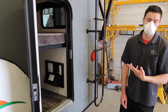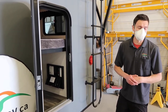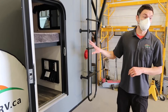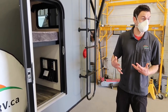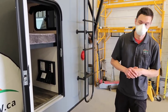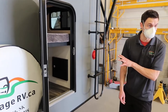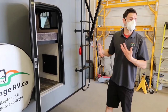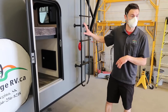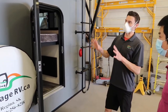I'd highly recommend buying a little two-dollar box of 15-amp fuses and keeping them in a drawer — you'll probably never need them, but they can save you in a pinch. Normally when something on the panel flips or pops, that's an indication of a bigger issue, so just changing the fuse may not actually help, but it's good to have them on hand. Also worth noting about the converter panel: there's a fan that runs inside. With all the lights on it's fairly loud, but at night when the lights are off and it's not working so hard, it gets much quieter.